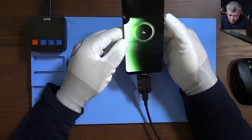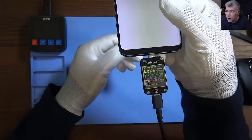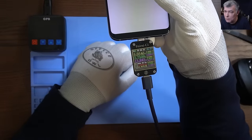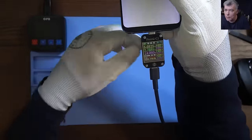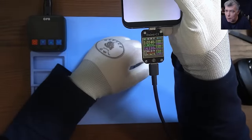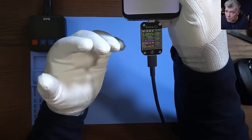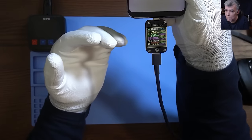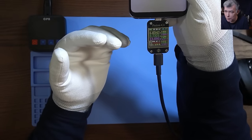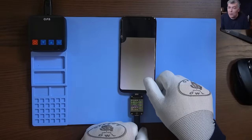You can see it's showing like 4 percent. So is this phone a working phone or not? If you have this job and you check the phone with charging, and you look at the charging values from the USB meter, you'd think this is a good phone or not? I will tell you straight away — this is a faulty phone.